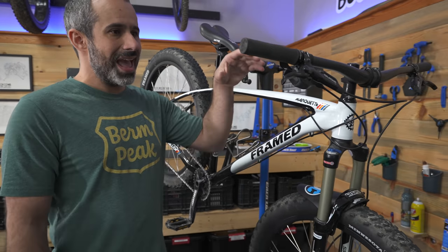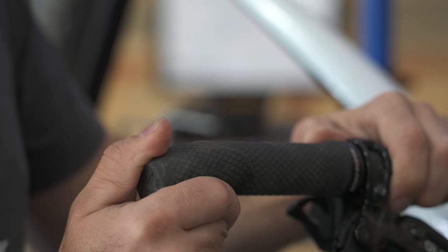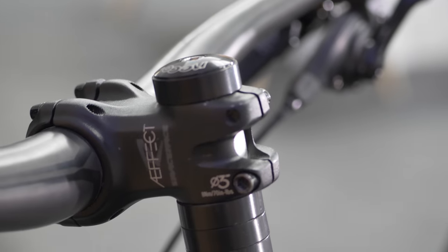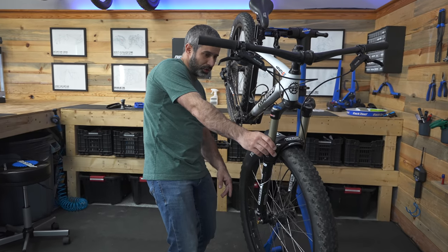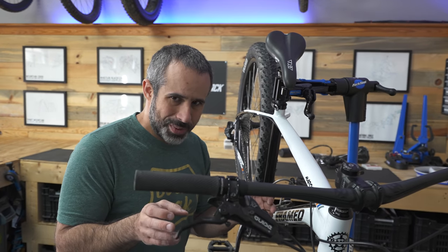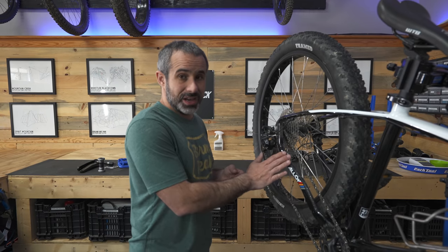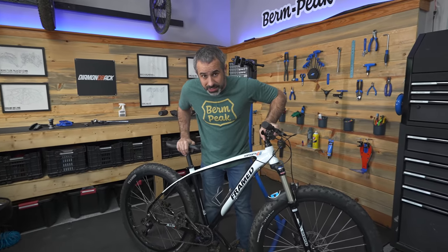We'll hook him up with a new bottle cage and this lock-on grip. I don't even know how this happens to a lock-on grip — it's not safe, he's got a little nub sticking up there. I think we're going to take some liberties and eliminate that, make it look a little cleaner. Wheels are not straight — we're going to true those. There is a mud guard here, and you can hear noise and think the tire is rubbing on it, but it's actually those little hairs on new tires. His chainstay has taken some serious abuse, so we'll hook him up with a chainstay protector. If we give this bike the drop test, it makes all sorts of noises. When we're finished with it, it's going to be a much quieter bike.